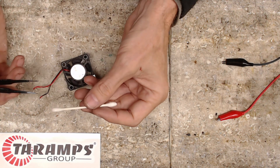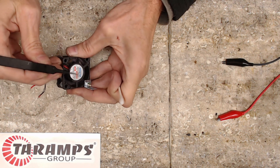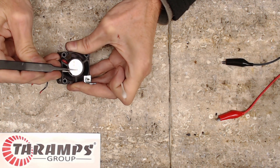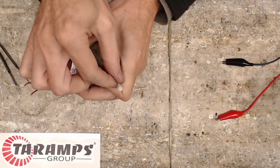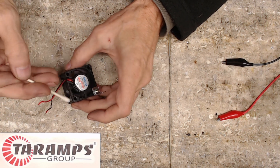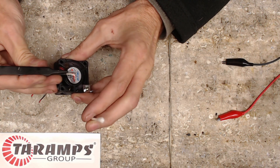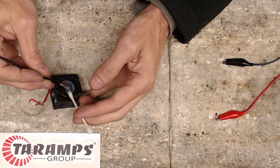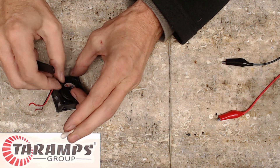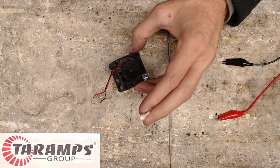Once we're done it will be at top speed and as quiet as ever. The cool thing is you don't need any fancy tools — just a Q-tip and some isopropyl alcohol. I put some isopropyl alcohol around the edge of the sticker and get my needle-nose tweezers right underneath to start a corner on the sticker. That isopropyl alcohol will get right up underneath and free up the adhesive. It's important to either keep the sticker or use Kapton tape if you weren't able to save it.